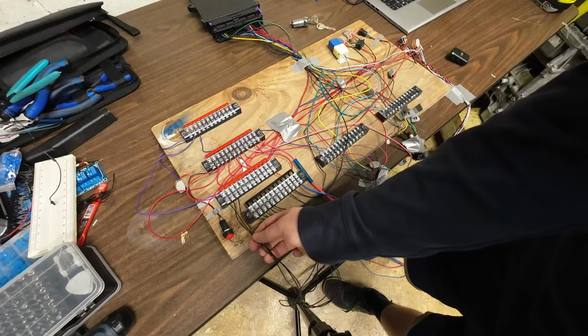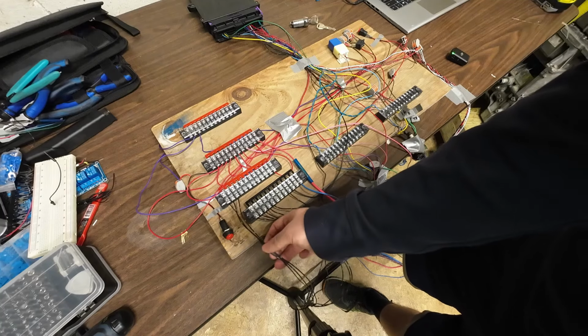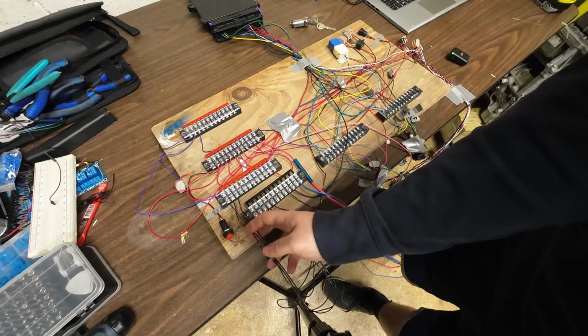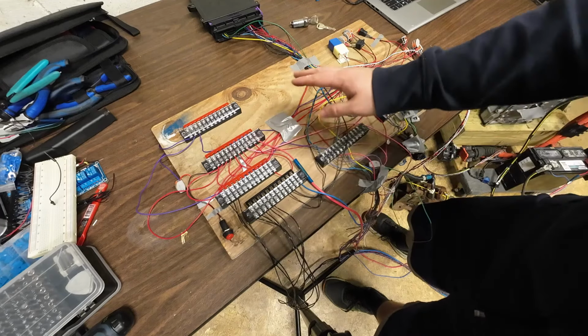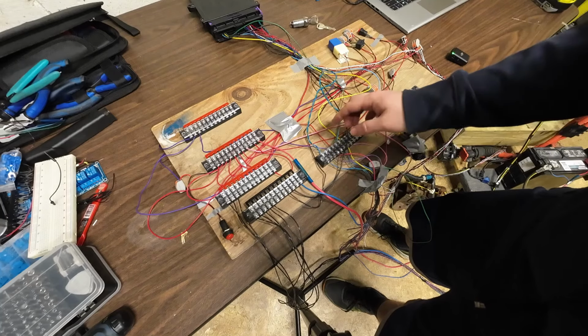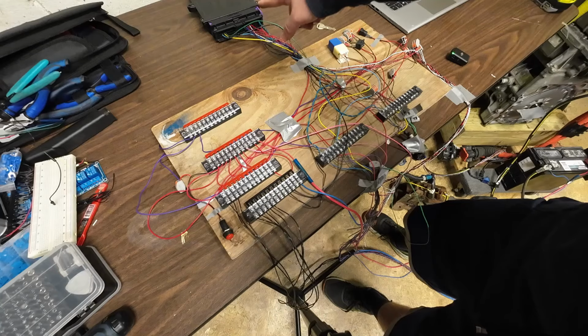Now, on Dala's battery emulator wiring diagram for his board, you use these as ground, so you have them wired up to the ground. And I didn't really question that when it came to the Leaf, just because things are pretty much wired the same. You have the same 3 types of wires for pre-charge, negative and positive contactors that go to the Zombieverter that's up there.